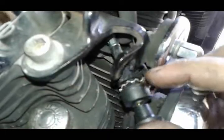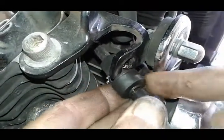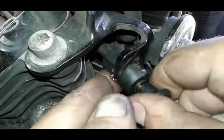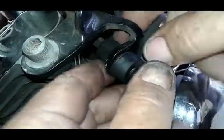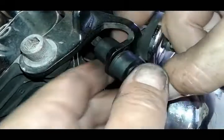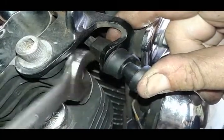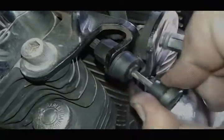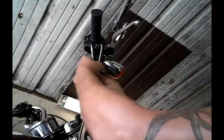Only thing left is to do our choke cable on the other side. We have our slot to slide the cable in — the metal washer goes on the back side. You might have to spin it to make it fit. Keep in mind this whole thing is made out of plastic, so when you tighten up the backing nut you only need very little tension on it — it's not going to come out. We're going to adjust our throttle cables and then start the bike up. When adjusting the cables make sure you still leave enough free play, otherwise the cables will be sticking. Put your boot back over.